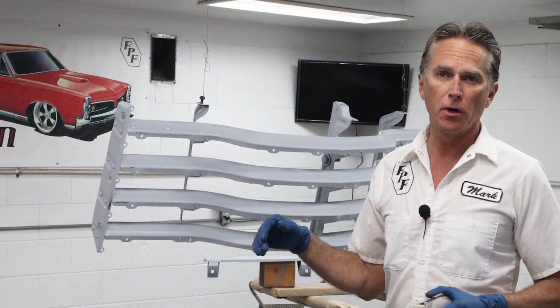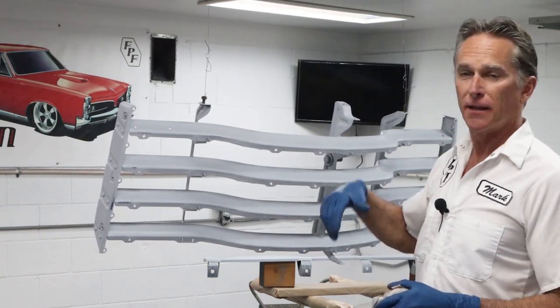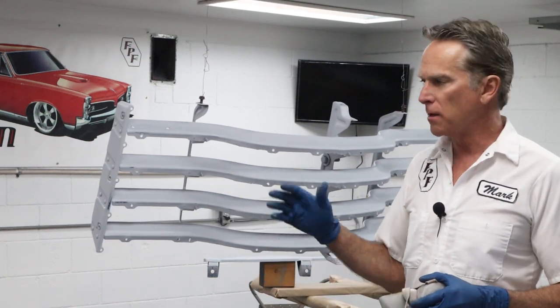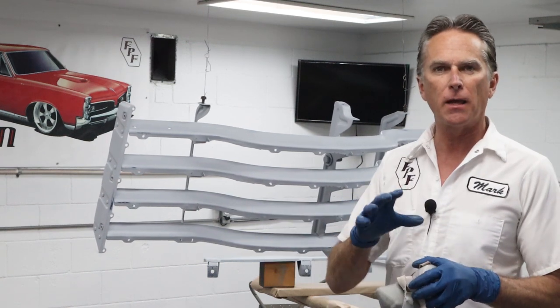It may take multiple coats for me, just messing around, squirting it in little spots and everything, and I gotta let it flash off completely in between. Last thing you wanna do is keep trying to hit a spot and put a run in or something. With this base coat, it dries really quick, but you still don't want to pile up paint in one spot.